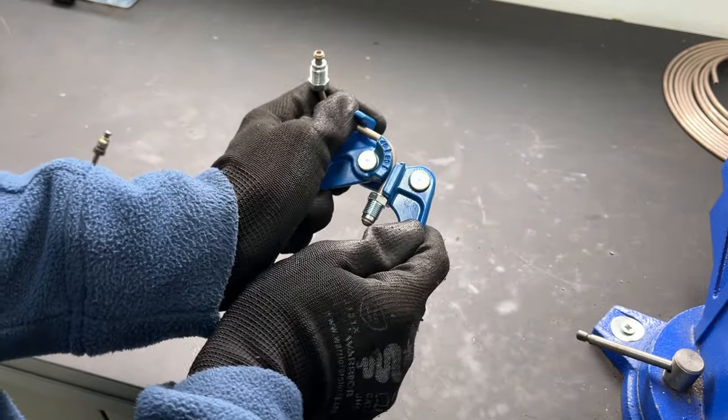Now we need to decide what to do about the longer brake hard lines. Driver's side front: although a bit dirty, it shows no sign of rust. Passenger side brake line is showing signs of rust. Passenger rear line: no signs of rust. Rear driver's side: a very small amount of rust just beginning to start. Underneath the car, this midline section which connects the rears has got a little bit of rust, and there's a junction box, so you'd only need to replace that mid section. Both rears are starting to corrode.